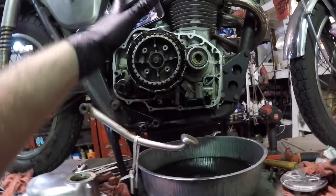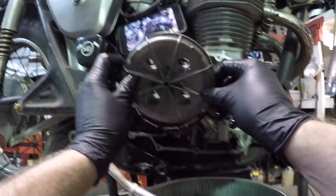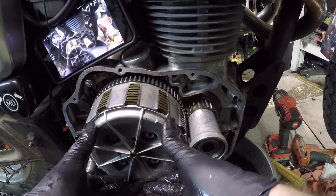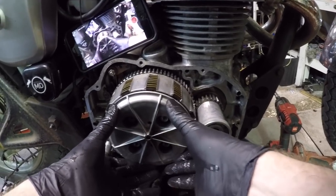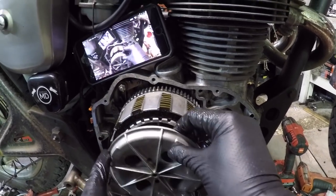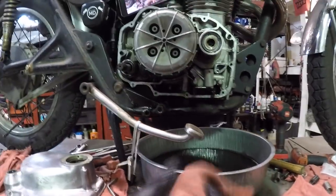All right, so our clutch assembly is reinstalled. We can go ahead and put our pressure plate back on. But what I will point out is knowing that it's fully seated and fully flush, all right? So when you put this plate on, this plate should sit nice and flush all the way up against that base, okay? All the way up against these other discs, almost like there's no free play. If I put this in one small turn to the left, you'll notice that I can't get it to go on. Okay, it's not seating flush. So making sure that you install this thing correctly, do another 180 degrees, lines up with the little fingers hanging out here, is how you know that it's on all the way. All right, so you just gotta make sure that you do have that.